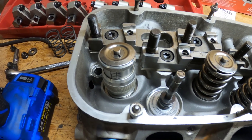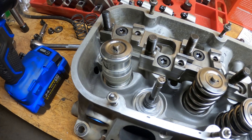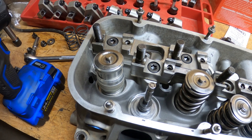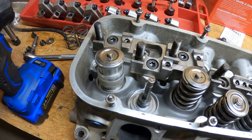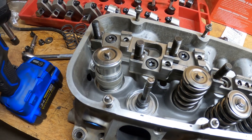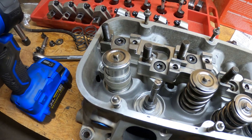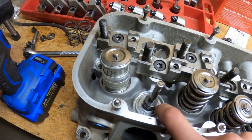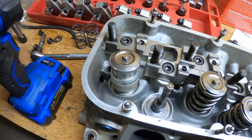I got some measurements taken and I'll get that info over to him so we can see what needs to be done with the spring setup, particularly whether the cam is right for the application. I don't know the lift or duration on that cam, but he should be able to hone in on where this cam works best at RPM. He'll also tell me what installed height I'm going to need on the springs given their rate, to help control the valvetrain.